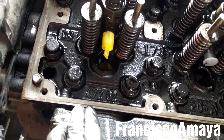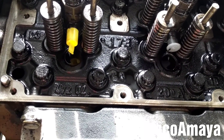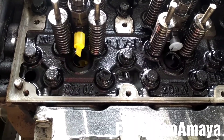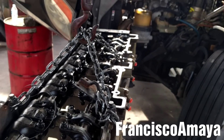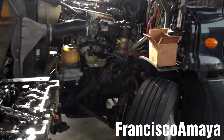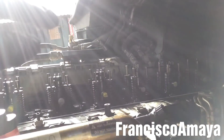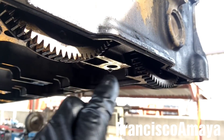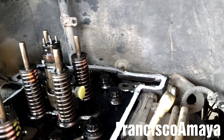Now I'm going to apply some silicone here to prevent any unwanted leaks. Detroit doesn't recommend applying silicone, but I like to apply it as my personal process — if you don't want to do it, it's not necessary. Now I'm going to start reinstalling the cam housing, making its way all the way into the engine. Before doing that, inspect there is nothing in between the gears in the engine — double check because you don't want any unwanted problems once you install the cam housing. Once the cam housing is in, I'm going to drop it on top of the head.